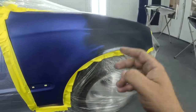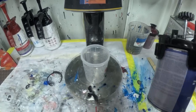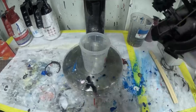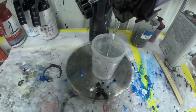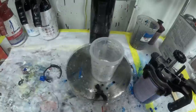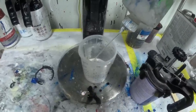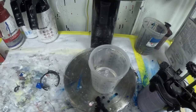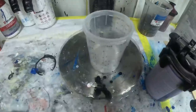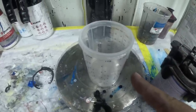Let's go into the mixing room and start with our first material. We're going to be using a transparent base coat — a base coat with no pigment. I'll link a couple in the description. This mixes one-to-one, but it's always important to check the technical data sheets to see how your clear base coat will mix. There are a few different names for it: clear base, orientation coat, air coat clear — they're all the same thing. Basically, it's a clear base coat that assists in the blending process.